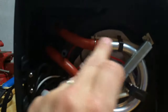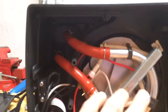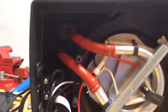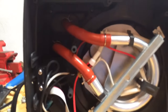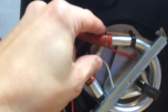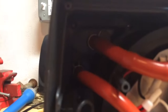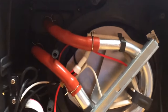So I took those two off and then removed the back. And there you see the heating element here, and then where I think the issue is — where the water gets drawn through and then the heated water goes up into the coffee maker to go onto the grounds. So I'm going to work on removing this hose, taking off these clamps and this clamp back up here, and see if I can find where the problem is.